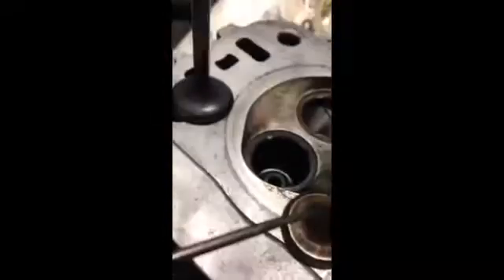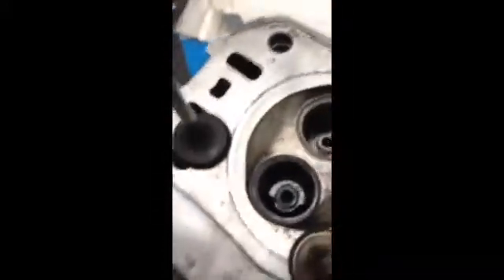What we're going to do is grind this off and polish this area of the valve so that the air, fuel, and exhaust can all move a little better, and reprofile these ports so that hopefully it will be a little more efficient and make more power.